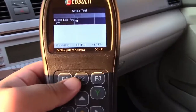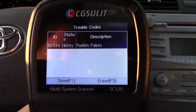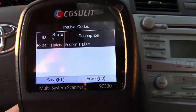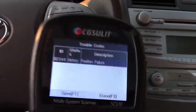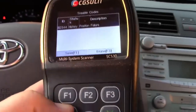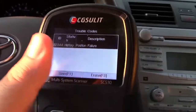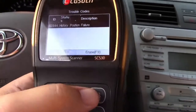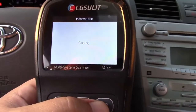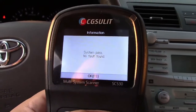There's a lot of cool stuff. Here's for the sunroof — I'm telling it to read codes. Take a look: there is a code for position failure. I actually induced that code just to show you. But we can clear that, and that is something you can't do on a $25 scan tool — it won't even get into this menu. Do you want to erase the fault codes? The codes have been cleared.